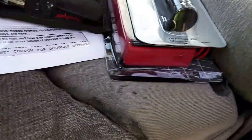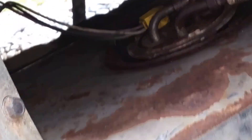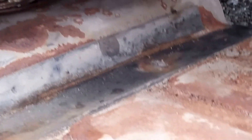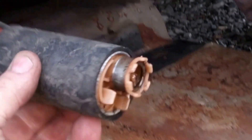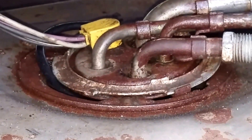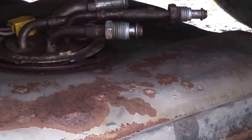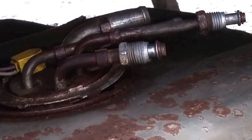I don't want to mess with those wires — it's a 22-year-old car — so I just got it to where I could use it. This is the old fuel pump pulled out of there. You've got to turn that ring off. The ring goes underneath there and you just have to undo all the connections. Take your time, be careful, and you too can change the fuel pump in your Safari.